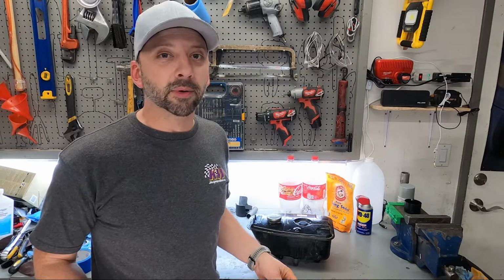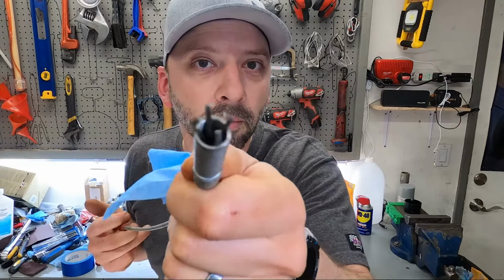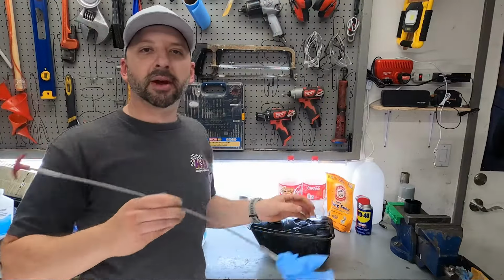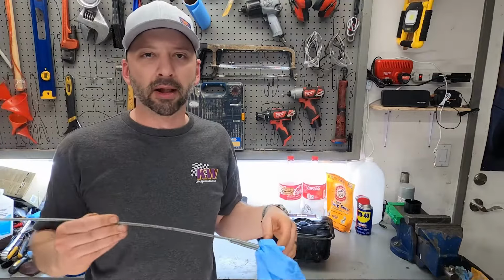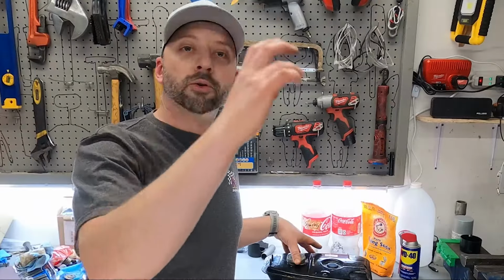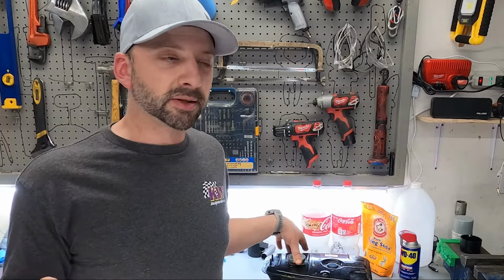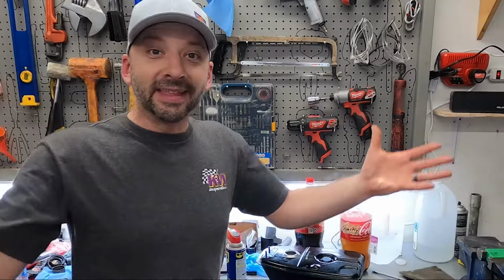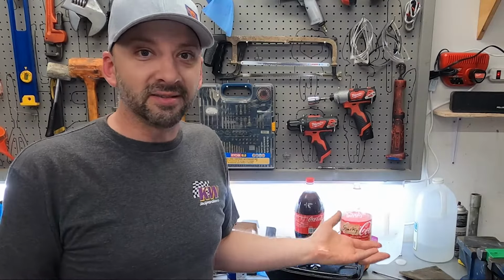And then working quickly, what I do is I get a rag along with a grabber and shove that down inside the tank and swish it all around. You'll have some remaining little residue or chunks left over, and you'll be able to clean that all out the best that you can. Then you need to go straight to filling it all up with fuel immediately. Again, flash rust goes real quick, so all the way to the brim with fuel. Then that's it, you got a rust-free tank for, I don't know, a couple bucks. The vinegar and Coca-Cola is cheap.